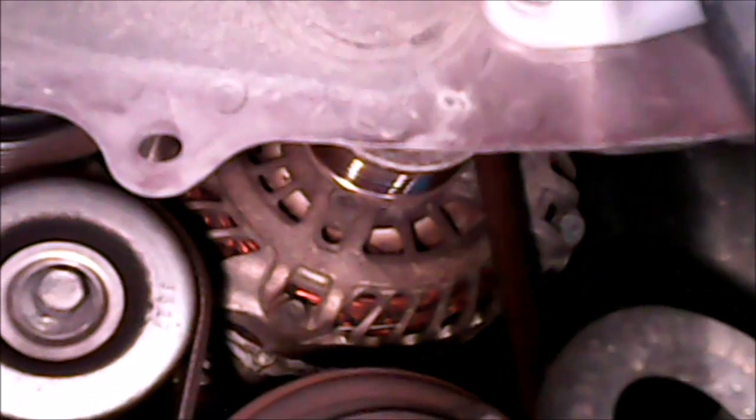I'll try to get some light in there — that is the alternator right there. I'm gonna pull the belt off and see what I can do. I dropped the air conditioner compressor. I took out two screws; there's one and a second one, and behind there there's two more screws that you have to undo on the other side.